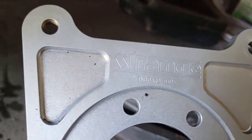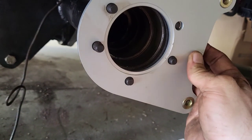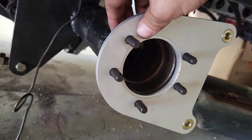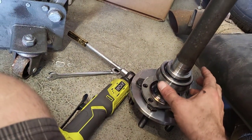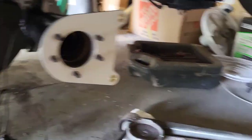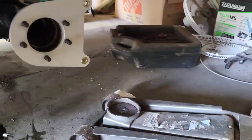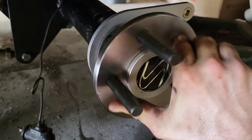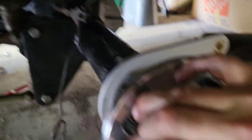Your backing plate for your brakes — you'll notice this one says 'inboard side,' pretty self-explanatory, just throw it on there. Then grab your axle. These are O-ringed so I'll spray some WD-40 on there to make sure they slide in. I'm not going to try to do this one-handed because I want to make sure it seats nicely. Got the axle on — it's a little tight, kind of had to persuade this one in with a mallet, but it is what it is.